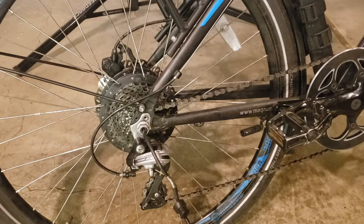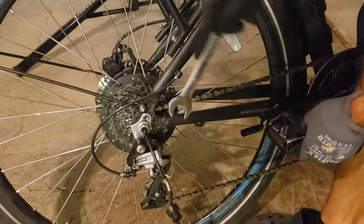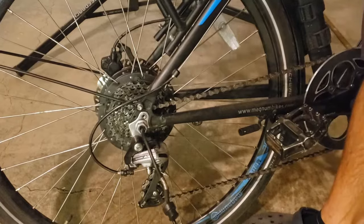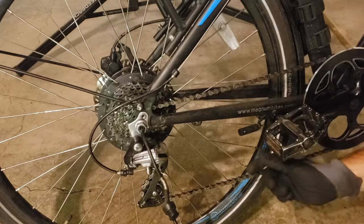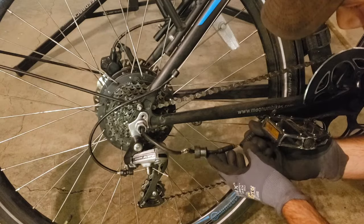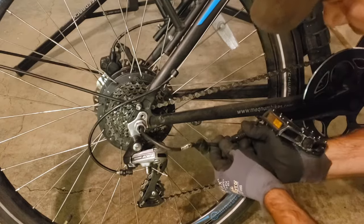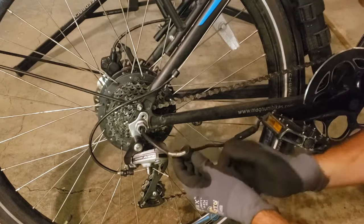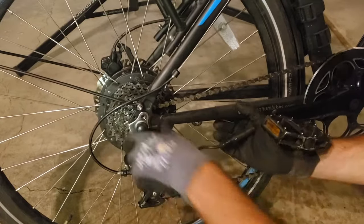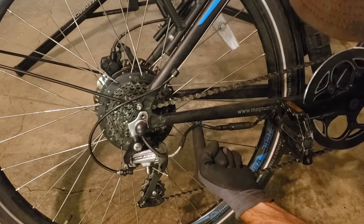All right, with the bike flipped back right side up, you can go ahead and tighten these bolts until they're pretty snug. Do the one on the other side, and then plug this back in. These typically have 2 arrows so that you can get the orientation correct. Just line up the arrows and then push it in. We can put this cap back on, and then also don't forget to pop a zip tie in just to keep that out of the way.